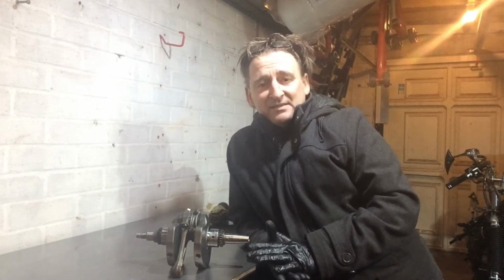In the next video I'm going to be cleaning everything up and reassembling it, and I'm hoping in that one that I'll see some sort of witness marks that show me where that metal came from. When I was tearing the engine down, I started to find little fragments of metal in the very outer side cases, but obviously as we got further in, just see more and more and more of it. So there's got to be something in those cases once I've got rid of all that gunky oil that I'll be able to see where it's come from. And it's been chopped up and thrown around, managed to find its way through the pickup and into the oil galleries, which isn't good. It wasn't in this case anyway, but I think we've rescued this admirably.